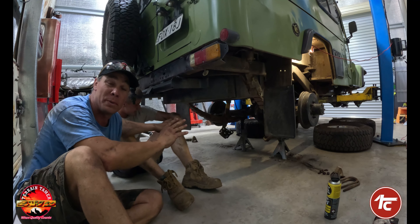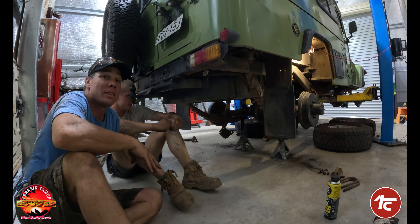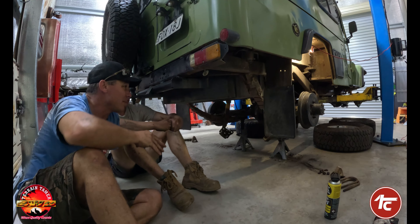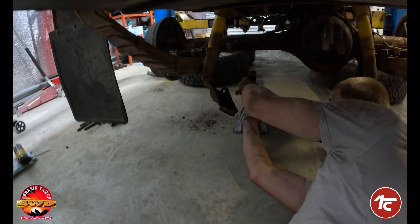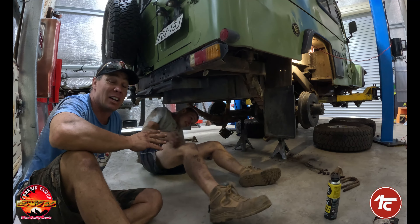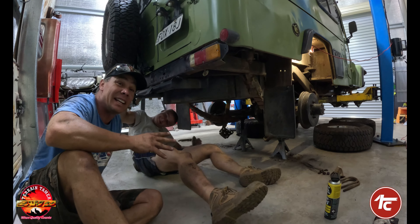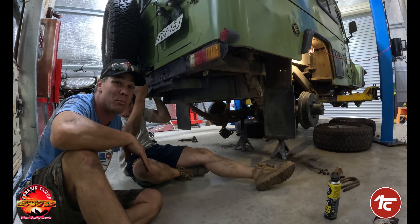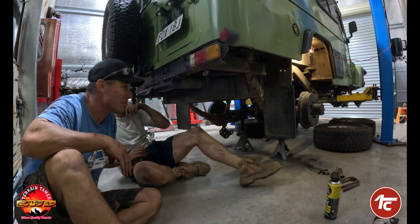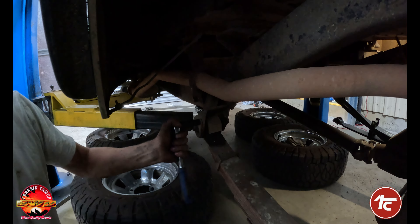The rear is a little bit different because the shocks are mounted to the support plate underneath, not somewhere we can leave the axle hanging from. So Jack has undone everything here. We've put stands up under the axle so we can lower it down onto those and safely leave the axle in place, then safely remove the leaf springs. Now these leaf springs are monstrous — they're around 60-odd kilos, so they're pretty heavy.